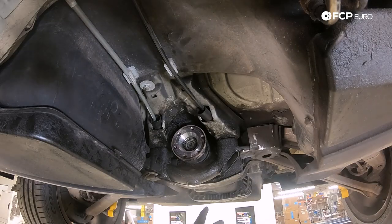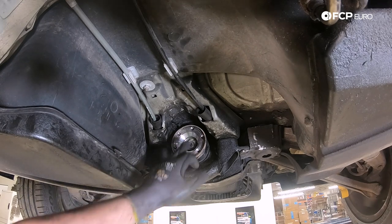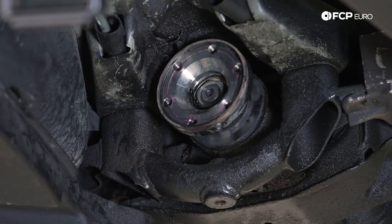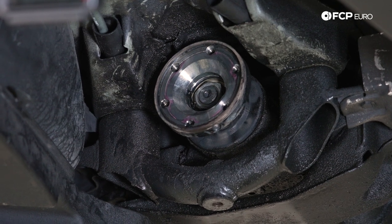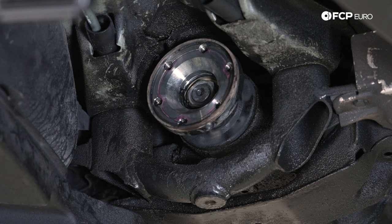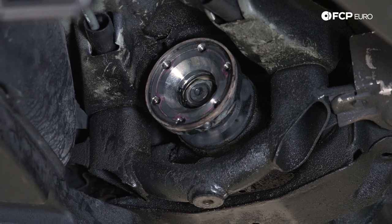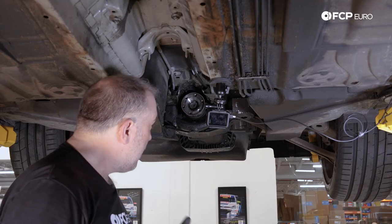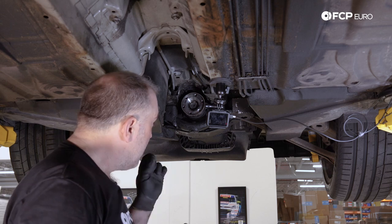Exhaust is removed, driveshaft is removed. Here's our pinion flange on the E46 M3. There's a lot of moisture all around this differential — I'm almost positive everything is leaking from it, but let's focus on just the pinion seal for starters. We have a 32 millimeter nut that holds the pinion flange to the pinion, and there's a little lock plate inside. First we have to deform the lock plate so we can physically remove it. When those are installed, they basically expand in two notches to ensure that the nut does not back off — it's kind of like a safety lock. Before we get too far ahead of ourselves, we need to mark both the flange and the nut. I'm going to use a center punch on both the nut and the flange and also use a paint mark, because when we reinstall the nut later, we want to make sure the nut goes back in the same position. There isn't really a torque spec for this, so we want to make sure that the nut is put back in the same place so that we don't change preload on the pinion bearing — if it's too tight the bearing will fail, if it's too loose the bearing will fail.